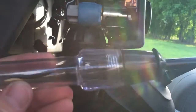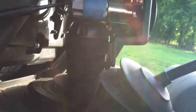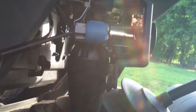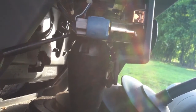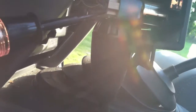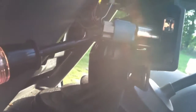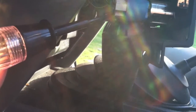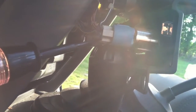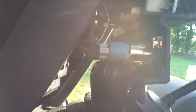What I've got here is a light voltage meter — it'll light up if you have a good connection. You can see I'm pushing on the black wire right now and nothing happens. When I get in here to the blue wire, you can see it lights up. So the blue wire is the hot wire. That's the one we're going to bring our power cable to, and then the negative I prefer to run to a ground. Now we're going to splice right into this one, and that should be about as good as it gets for wiring.